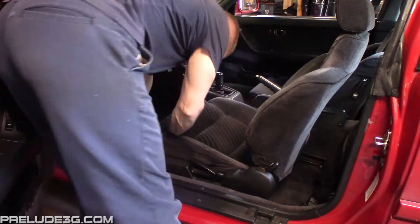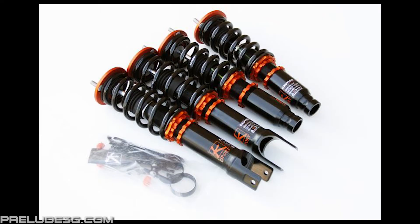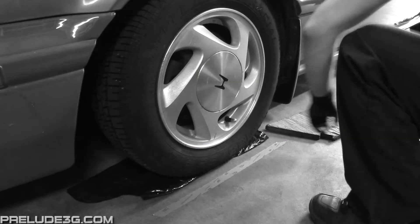Pull the car forward into the alignment space, then load up the driver's seat with weights that match your weight. The car should also include any other weight that's normally there, like tools in the trunk or a heavy sub. If you have adjustable height suspension, you need to set the ride height where you want it before you do the alignment. If you make any ride height changes, then afterwards you'll need to at least adjust the toe again.